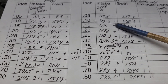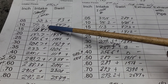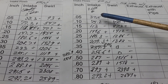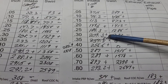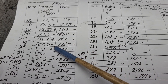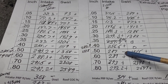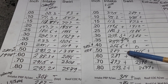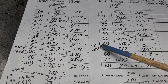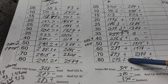Only down a little bit, but it makes a difference. That high speed on the short side radius was helping at the lower lifts, which may not be good for my street application. Then it's plus, minus, plus, plus, plus. 209 and change is higher than I was expecting — it was 208.7. 235 is good, plus. Went down a touch at 500 — went from 290 to 287, lost 3 CFM. And lost a tiny bit at 0.567 but gained a little bit way up top.